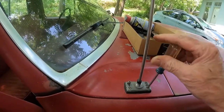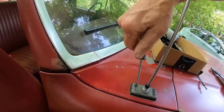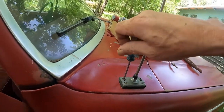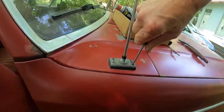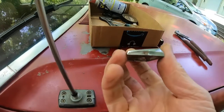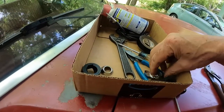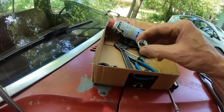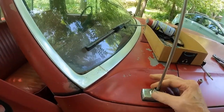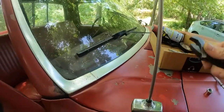You've got your pegs aligned — you don't want it going the wrong way, you want it straight. That little bevel there keeps the antenna kind of straight. You don't put the bezel nut on yet, and those threads that I tapped in there help everything stay. This only goes on one way — see, the bevel goes like that, pops on. Then you just tighten that up a little. Now we're going to go in and connect it to the radio.